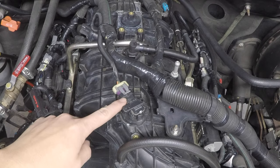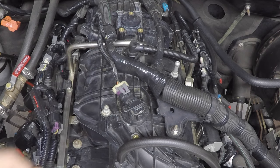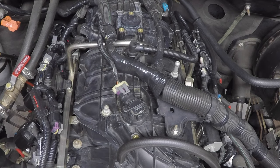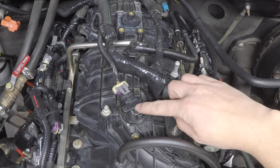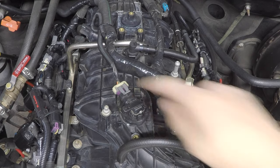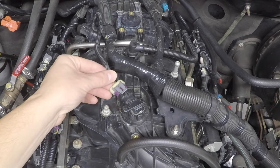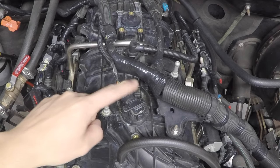The MAP sensor on the truck intake is located towards the rear, but on the Trailblazer SS manifold it's towards the front. The older and newer body style MAP sensors differ in connector type and sensor diameter. The newer intake uses three different mounting methods: a click-bar-and-stud, a single side bolt, or two tabs. I recommend using your OEM MAP sensor rather than the newer style, as the tuning software will have an easier time, and you avoid connector compatibility issues.